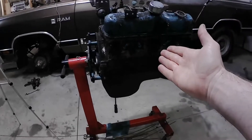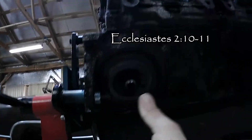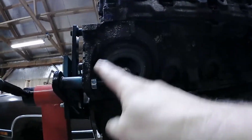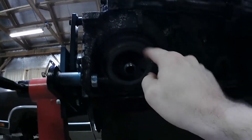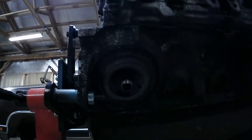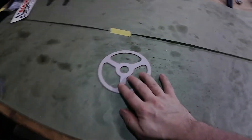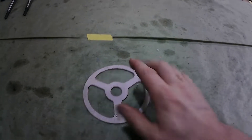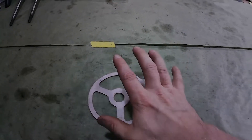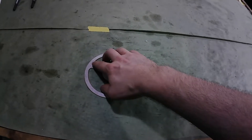Okay, why are we staring at this? Because this is the piece I'm talking about that goes up in there. It gets bolted down with a little oil filter adapter, and there's a gasket underneath there. The book didn't really help me out, so I went to the A-Bodies Only forums. This is another gasket I had — one of my spare ones. The guy had the exact same problem I did: high volume oil pump, small block Mopar.